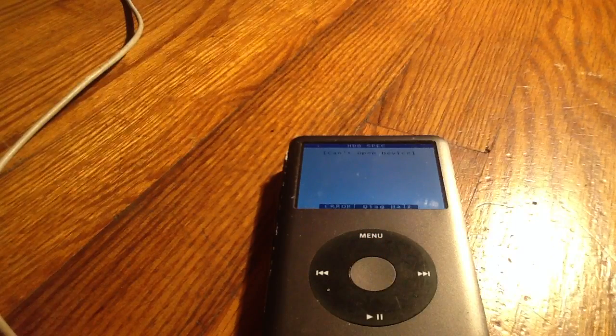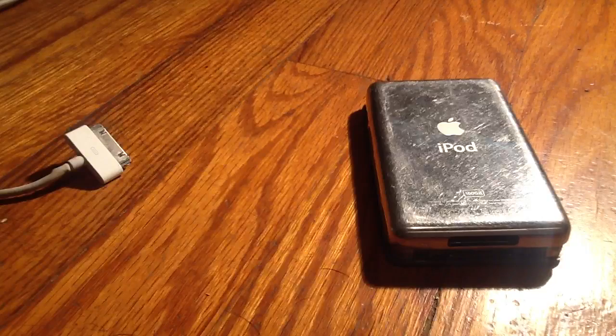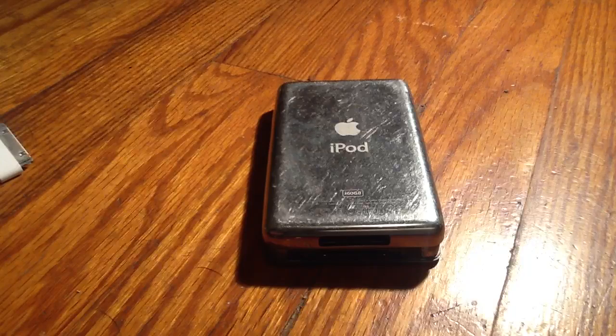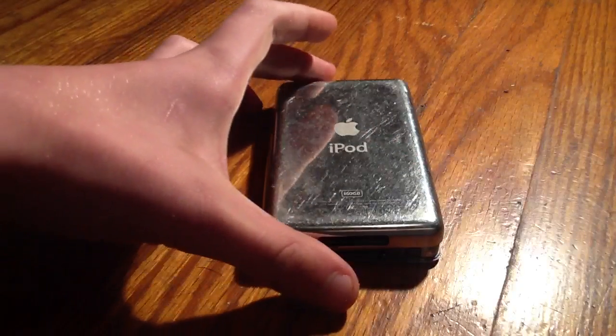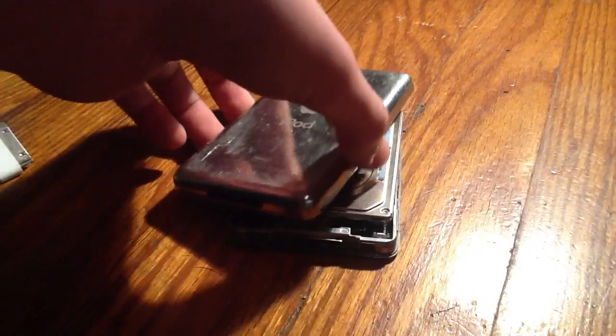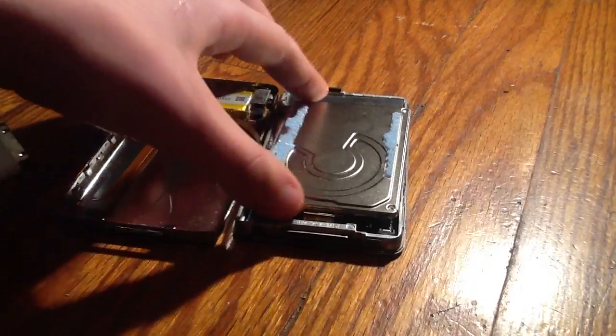Now that you know it is the hard drive, to replace it you'll unplug it, flip it on its back, and once you know how to open it and you've opened it correctly, you'll want to take it and move very carefully. Maybe take the power strip plug in the bottom right-hand corner and pull that out — you can reattach it at the end, so don't worry about permanently messing it up. And then this is the actual hard drive.